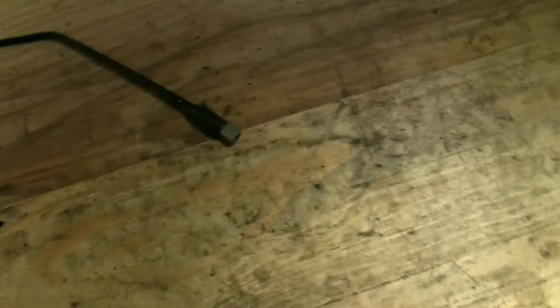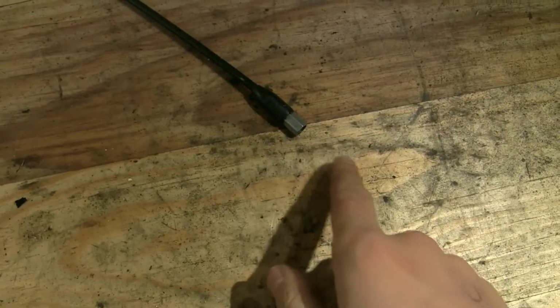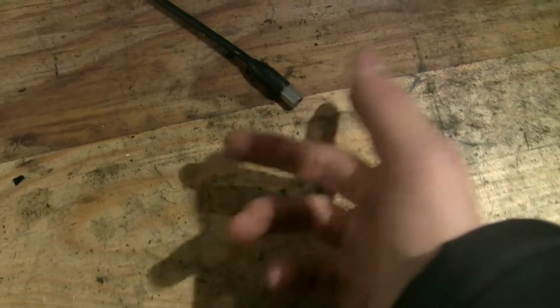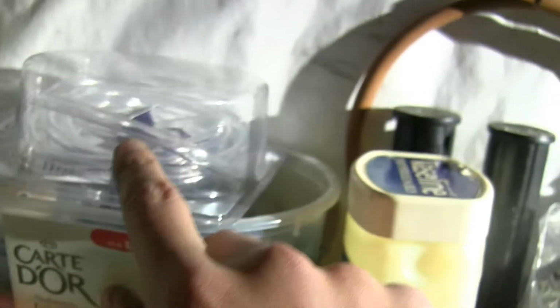Right guys, so I have fitted it. The reason it was clicking is because in the throttle there is a part where the wire would connect into the throttle and bend at a 90 degree angle. Someone had sanded that, and there was a stiff bit that was shearing pieces of the wire off, which is evidently why it snapped. What I've done is I've got some of this tubing, I've wrapped it with duct tape so it doesn't break either, and I've threaded the wire through that.